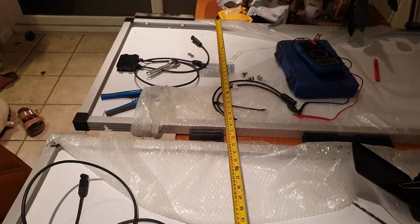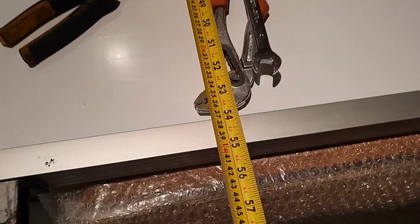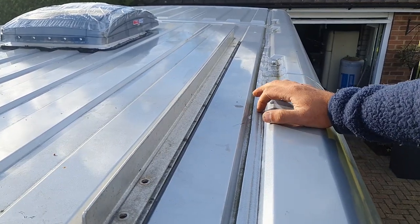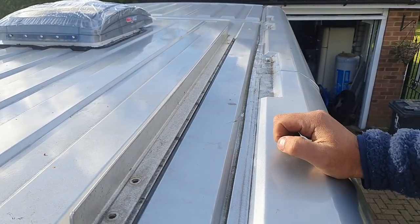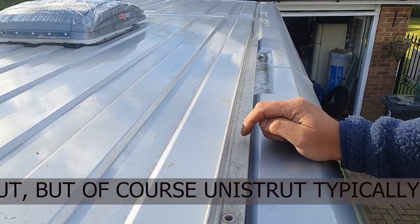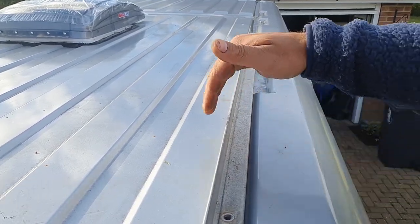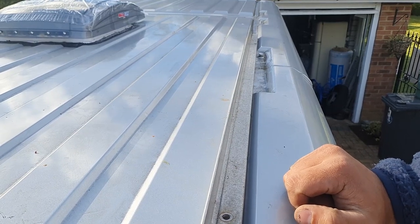The magic number we're looking for is bang on 1.4 metres or 1,400mm. So these are our channels — they're 30mm wide and approximately between this innermost edge and the innermost edge on the other one, 1.4 metres or 1,400mm wide. So we'll fill this with mastic, put these brackets in the middle, bolt them down with some big M8 bolts and some big square washers on the inside, seal the holes with a load of mastic also, so we'll just drill straight through, and the panels will then bolt onto this edge and sit between themselves with the improvised spirit level spacer.